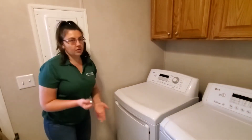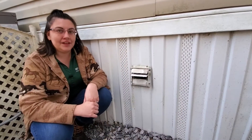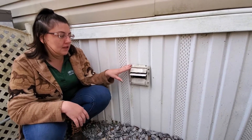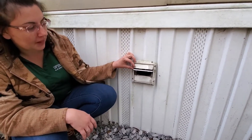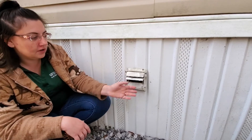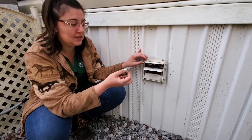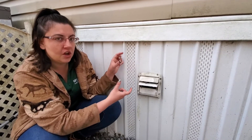That's one way to clean out your dryer lint, but there's one more place you need to do — and that's outside. Outside of your house somewhere you'll probably see one of these small vents. This vent is where all of the heat from the dryer comes out. When the dryer is running you can see that these flaps are open; typically when the dryer is not on they'll be shut. In addition to all of the heat, there's also a lot of lint that comes out and gets past that filter inside, so this is another spot where it's important to clean it out because this stuff makes really good fire starter and you're pushing hot air through it.